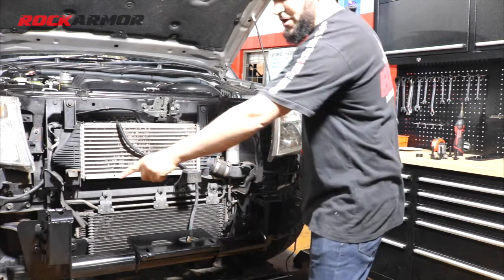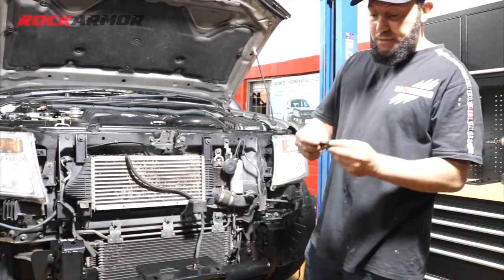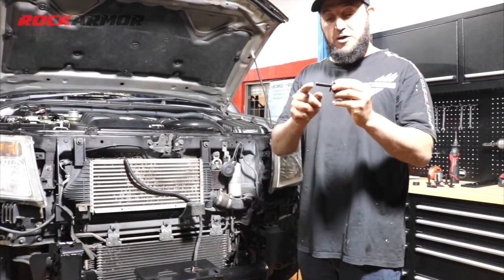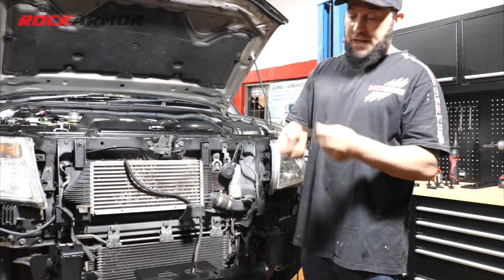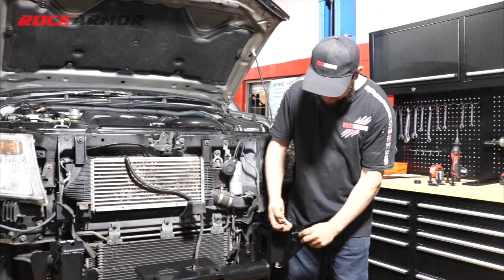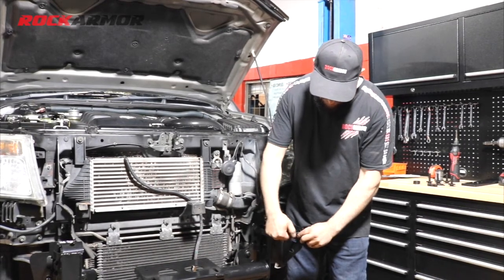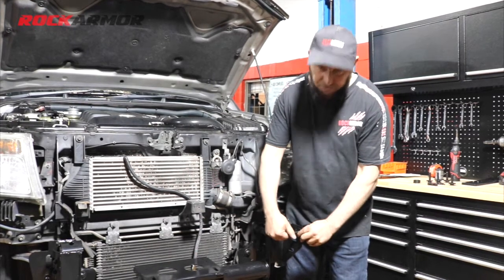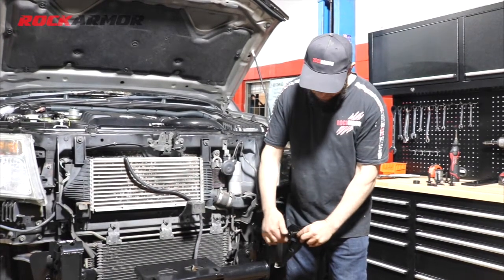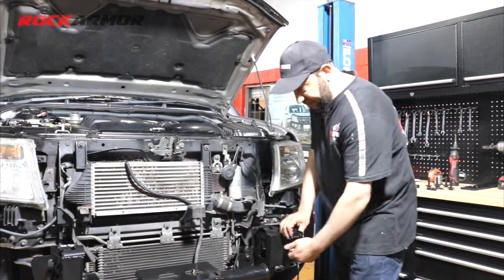So there's 3 on either side, and they just marry up with the bull bar there. And I'm using the long bolts there, they've got the fine thread. I'm putting the washer, and then I'll be fitting them through the outside in. Then I'll just be putting the flat, spring and nut. And if you have Loctite, you can also use Loctite on these. So that's how it's going to be mounted there, and all 3 on either side.